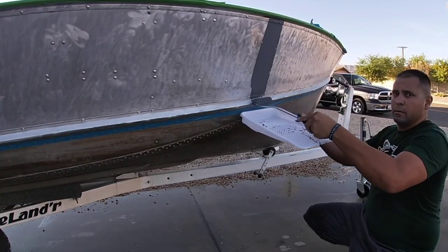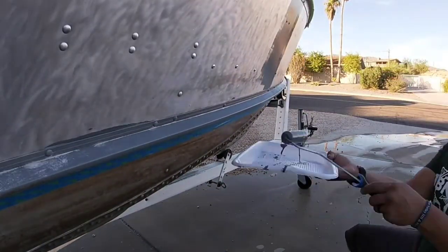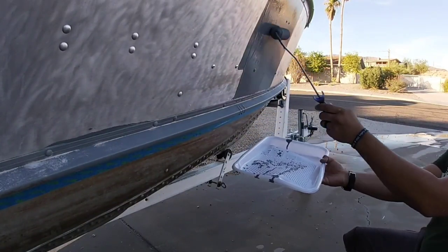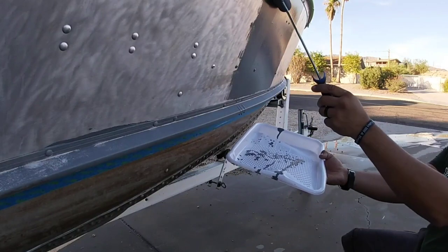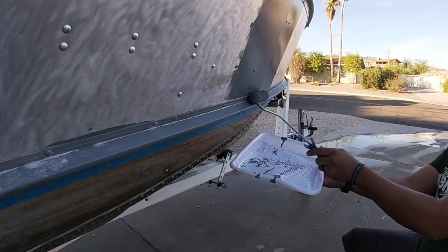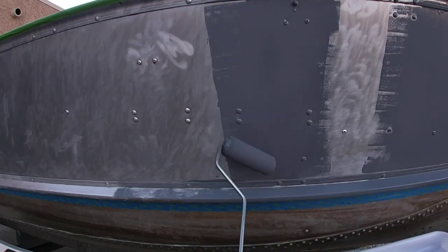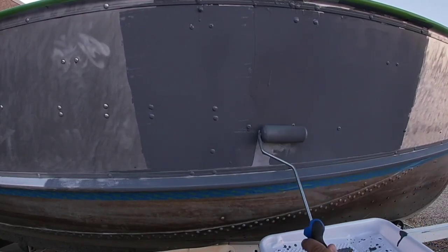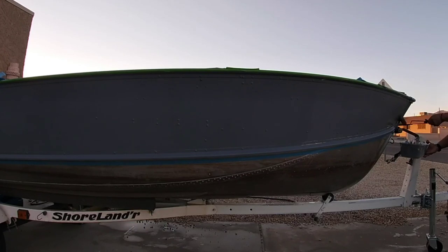Fail one - don't do this. Don't put it on too thick. Multiple thin coats are way better than fewer very thick coats. You want it pretty thin to avoid orange peel. I just thought the stuff would dry way faster than it did. It dried pretty quick once it was on there, but in the actual kit, I was worried about the hardener catalyst. It actually stayed pretty pliable for over an hour. I thought it was gonna dry within 20-30 minutes, so I kind of panicked and spread it on too thick - and that was the road to nowhere, as you'll see pretty soon.